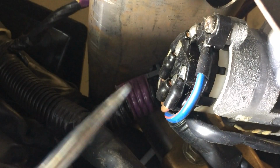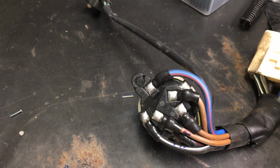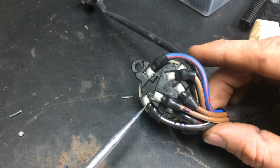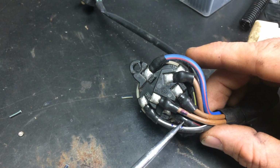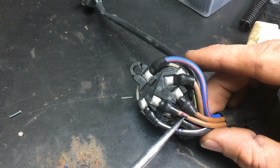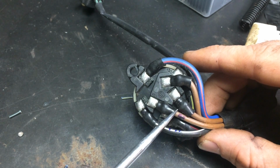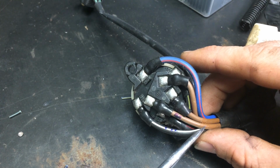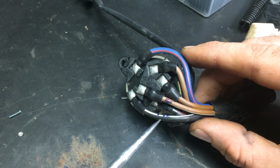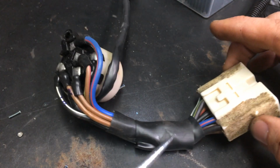I'm going to take this apart so I can better look at it now. So this is the ignition wiring taken out of the car. And from what you can see where I mentioned earlier, this black wire that I've marked, it comes off the starter wire, so this is going to need to go to the starter relay. And this is the ACC, so when I turn the key into the ignition, it's going to send power out here. It's also feeding the rest of the car to the dashboard and everything. So I'm going to have to splice into this to get my power to go back to the LSX computer. And this black wire, I no longer want going through the circuitry of the MR2. So I'm going to come through and I'm going to pick it out of the actual plug. I'm going to wire it back to the starter relay.